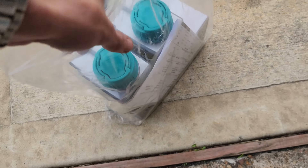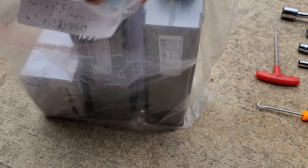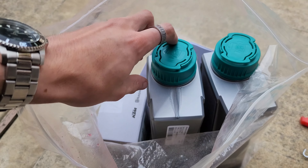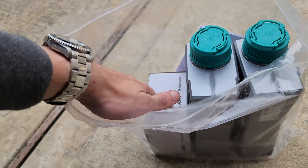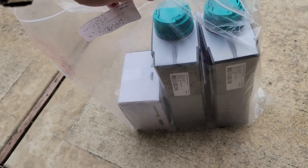So what do you need for the oil change? You're going to need the oil change kit from KTM or Husqvarna. It brings 2 liters of oil, but you will only need 1.6 liters. It also brings a box with the oil screen, the strainer, and the new bits and pieces you need, like the oil drain plug, oil filter, and everything. So you're going to need the kit.